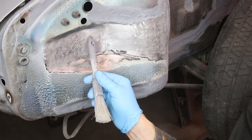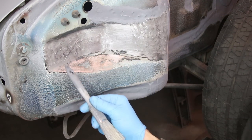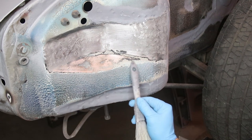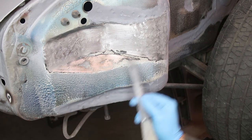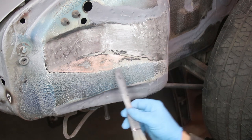I knew there were no holes in this panel because I had to touch up a few of these with the TIG welder. I've gone over this with the wax and grease remover and I've also feathered out the undercoated edges with some coarse paper — some leftover paper I had from the filler. So it's ready to paint.